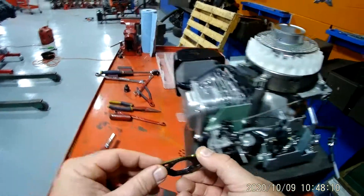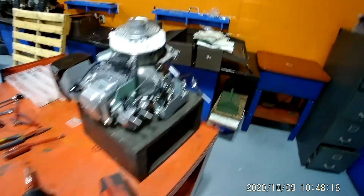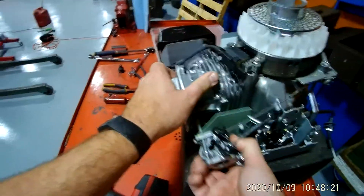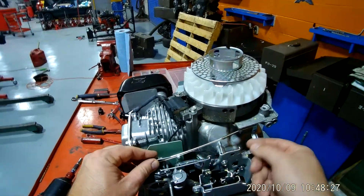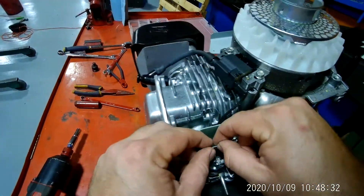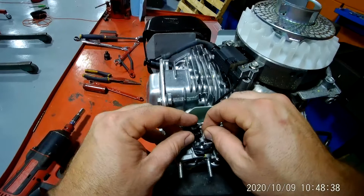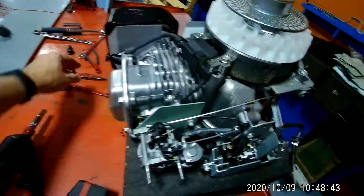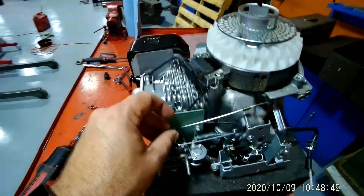The carburetor's got a gasket. I'm going to put my bolts and two nuts for the carburetor aside. This carburetor should just slide off. I can see I've got two rods here — this one right here actually has a spring and a rod connected to it. You need to remove these rods and the spring carefully. This takes a little bit of force; try not to bend it too much — do it as easily as possible.